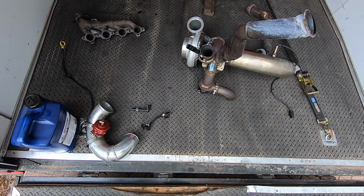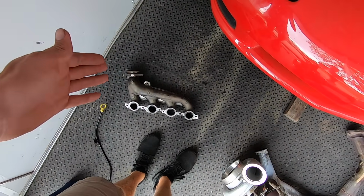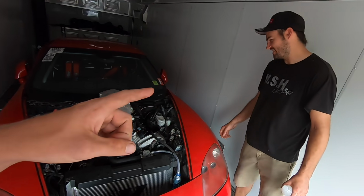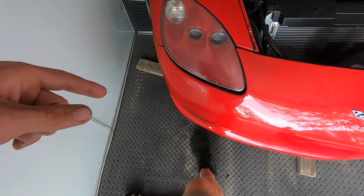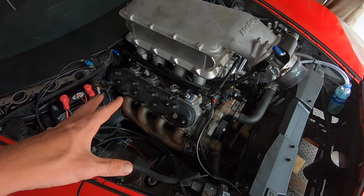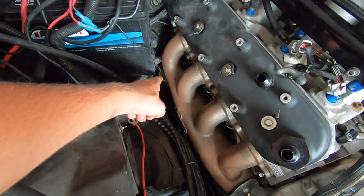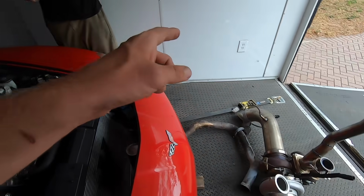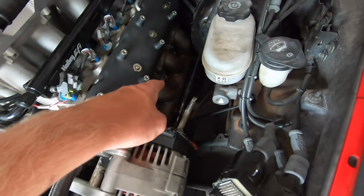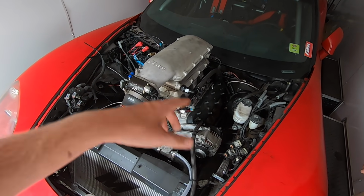So folks, unfortunately, after all this time, this tube is probably going away today. As you guys know, our old turbo kit did not fit any longer. The other one's under the car because I couldn't get it out, so I just had to drop it through. This morning I went to the shop and I knew we had these Holley Hooker headers there, and I put them on the car just to make sure they work. They're actually pre-made turbo manifolds. There's a V-band on the back there. It comes with that crossover tube that's in your garage, and that crosses over to this side. It's just another log style header over there, or manifold. And these actually clear 6-bolt heads perfectly.